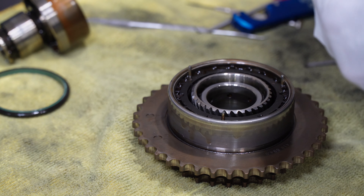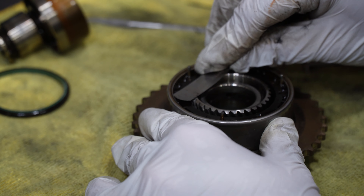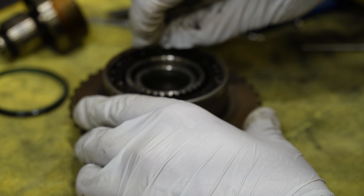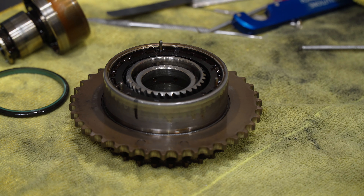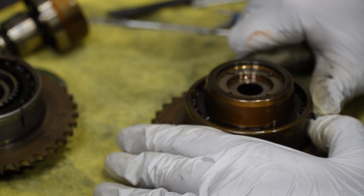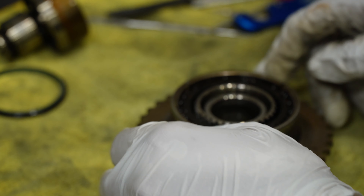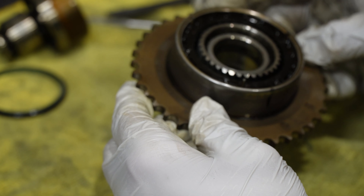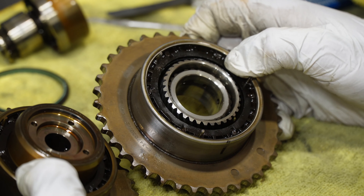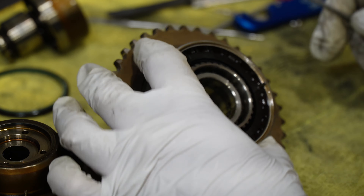Now we're going to put the bolt back in, use the vise one more time, and hit down until we come off of the housing. You can see it squeezes down quite a bit — it's crimped super duper tight. There's no chance of getting a feeler gauge in there. Your smallest feeler gauge is going to be six thousandths — there is, in fact, zero gap there. Before crimping, I was able to rotate the plastic housing, but that's not going anywhere now. You can see the indentation right here where it was rolling. That's pretty cool.